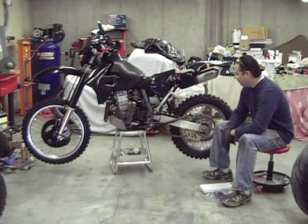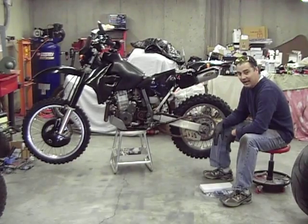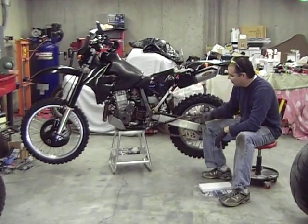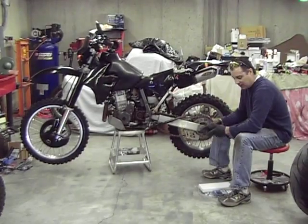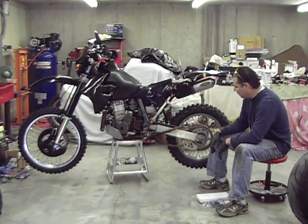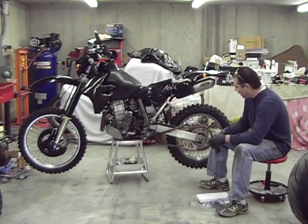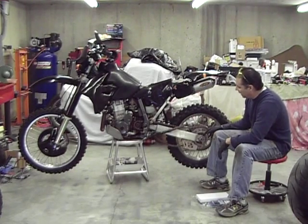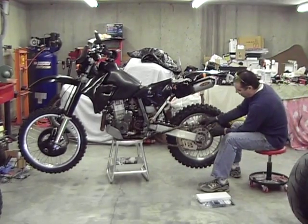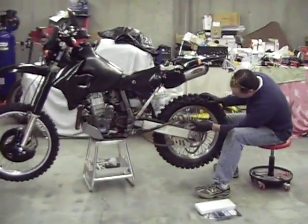As we were inspecting Everide's bike, we started to notice that his sprockets are pretty well had. So we're assuming the chain is worn as well. The way you test it is you can measure from a certain number of lengths based on what the manual says. But when we saw the sprockets worn out, we decided you've got to replace the chain too. Ideally, to get longevity, you want to replace everything. You can kind of hone in a little bit, and you can see on his sprocket all of these teeth are pointed forward.